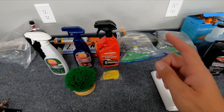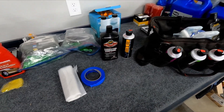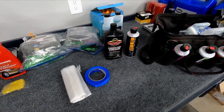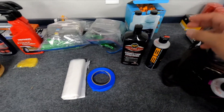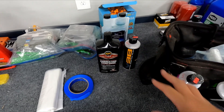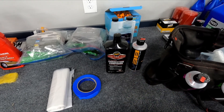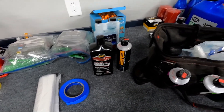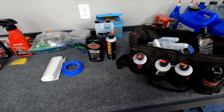Now that the car is clean, I'm going to go over it with the clay bar, then tent the top with plastic and mask off all of the soft rubber parts, because I don't want those to turn white if I get some polish on them. The car is in decent enough shape — I think I'll just use this Meguiar's correction compound on a microfiber, maybe some final polish. I've had really good results with just doing a one-step correction and then glaze, sealing, and waxing on top. With the car being as small as it is, it should be relatively quick — should be able to get it done in a day.